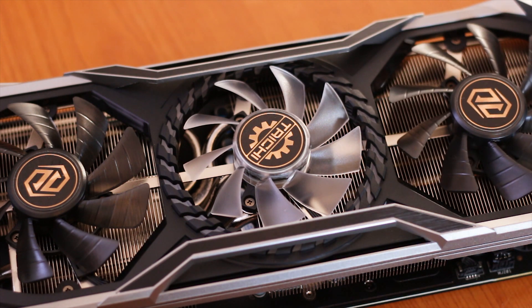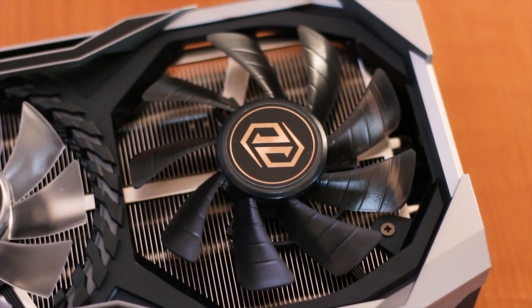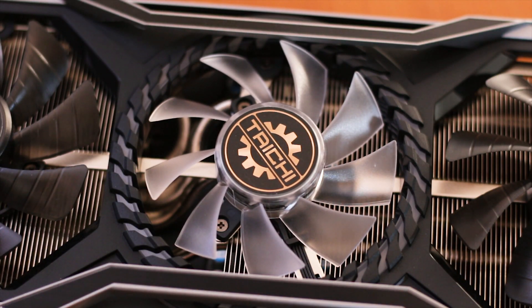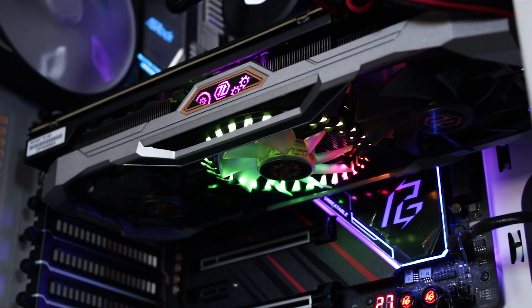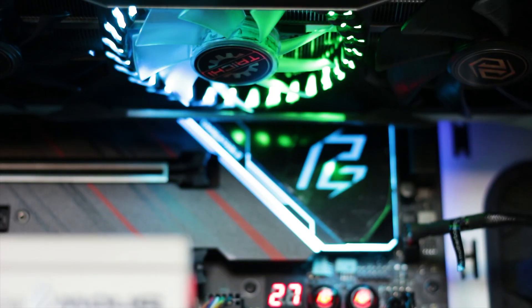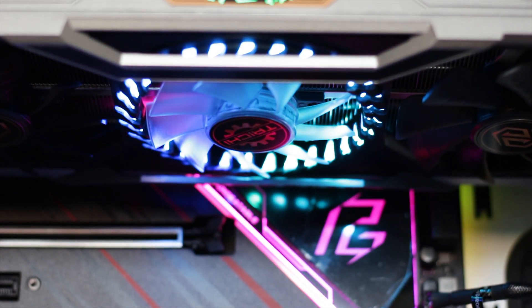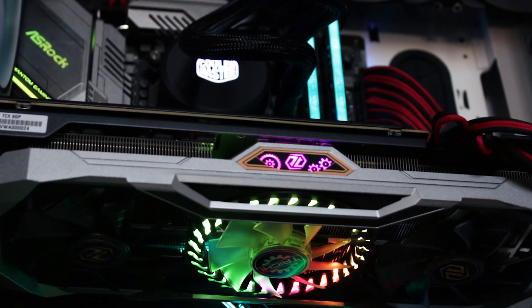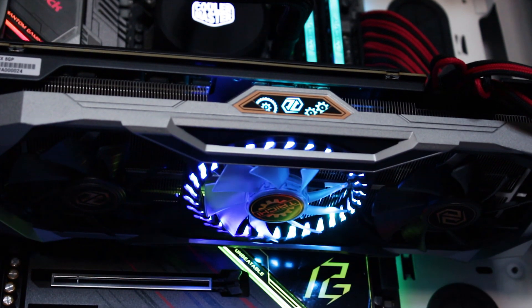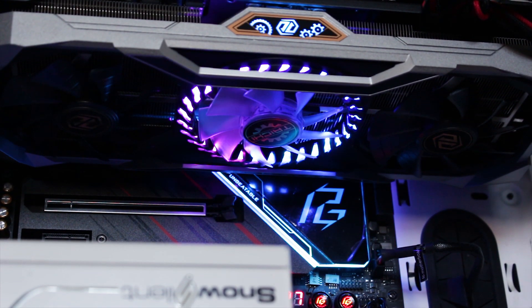These fans are different in size and design. The outer fans are identical with dark smoked semi-transparent impellers, while the center fan is rather simple in design with no fancy impellers or colors. The center fan is semi-transparent to allow more light and color from the RGB LEDs to be diffused outside the graphics card and into the system. Also worth noting is the 0 RPM feature, which keeps all three fans stopped when the card is not under heavy load — reducing noise and increasing fan lifespan.